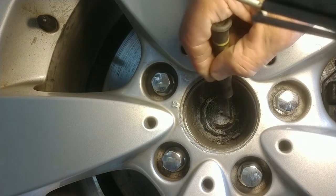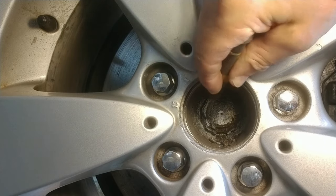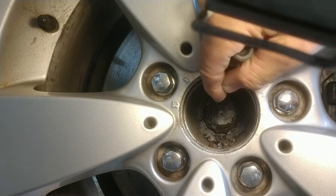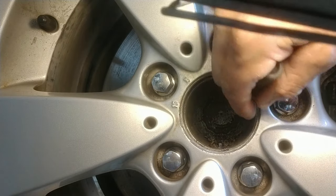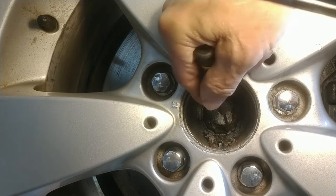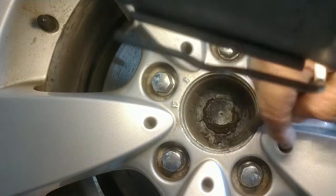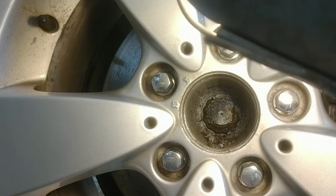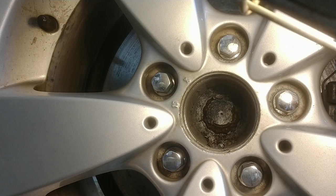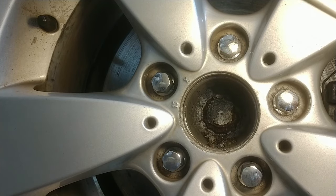You can just see what I'm dealing with here. This is ridiculous, but this is what the other side looked like — just the vaguest hint of where you even get to the proprietary 34mm hub axle bolt tool that you have to use for this car. I had to buy lots of big tools to get it done. The trick first is removing the worst of the rust before you even try to take it off, so I'm going to continue picking at it with, in this case, just a small screwdriver.